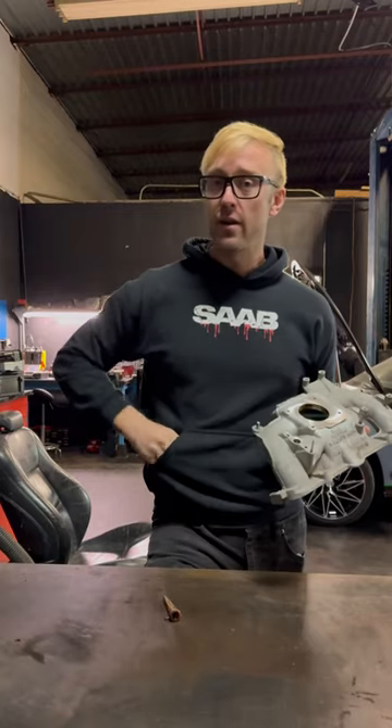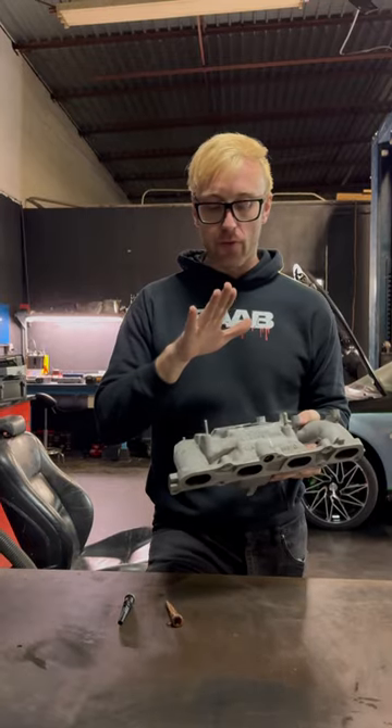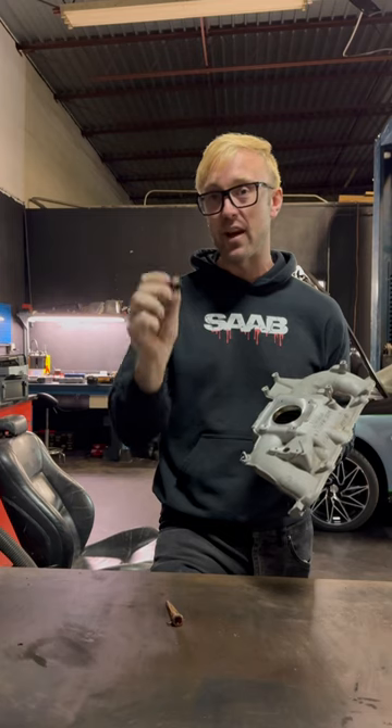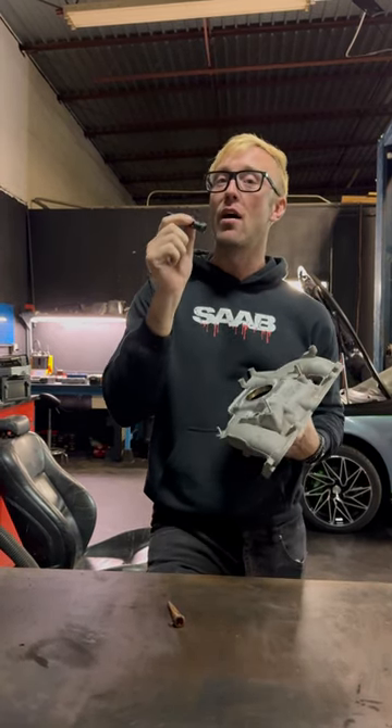So I've got a good one here — you should not be able to blow through it. When you're doing any type of throttle body gasket work or anything along those lines, go ahead and change this while you've got it apart. It's definitely worth the $12 to $20 to save you the hassle of losing your boost.